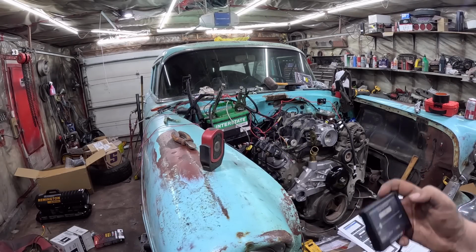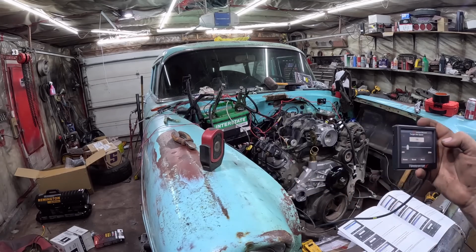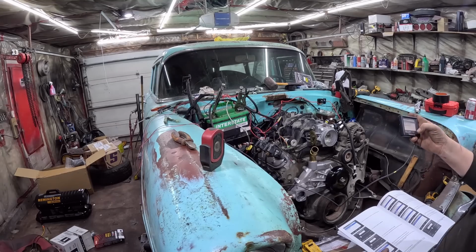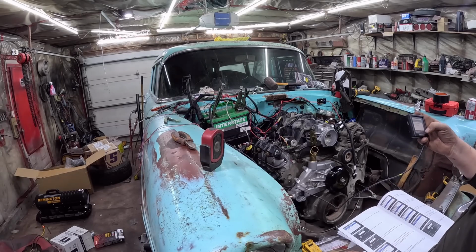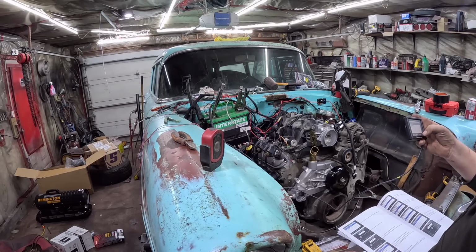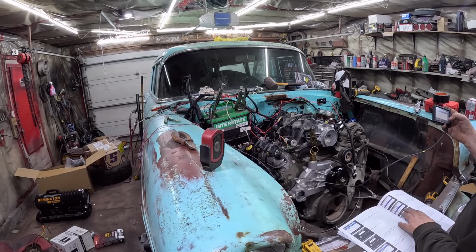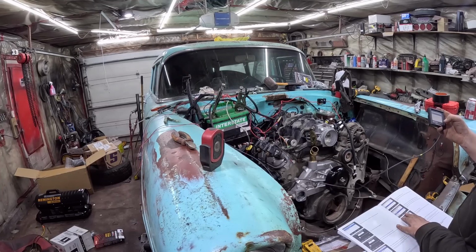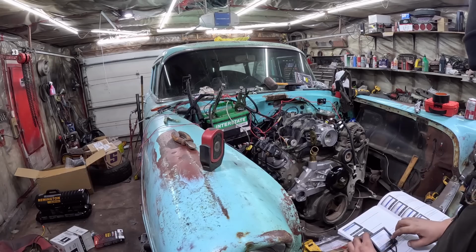So anyways, all it's asked so far is what this thing is. So 6-liter LS. You know, we'll give it like a 700 something idle speed. Next. Camshaft. Huh. Below 235. I guess we'll just leave it there. 24 tooth. Fuel pressure. What the hell are we going to put there? We'll do 60 psi. I think that's what it is. Injectors. OEM. Oh, yeah. It asks for the OEM number. This is where I'm going to Google it.